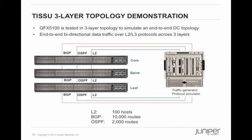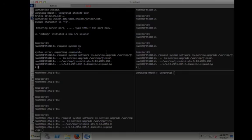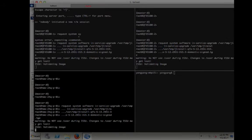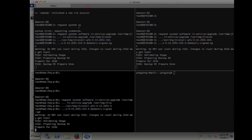Let's look at the actual test. Here is the Spirent Test Center window — the exact same test setup is used on this three-layer topology ISSU, with OSPF, BGP, and layer 2 traffic. Starting traffic now. Here are the consoles for all three switches. To save time, the image is already copied and the configuration is already in place. Hitting return on all three switches to kick off ISSU simultaneously. Now ISSU is running on all three. Taking a short break — we'll be back to check the result.